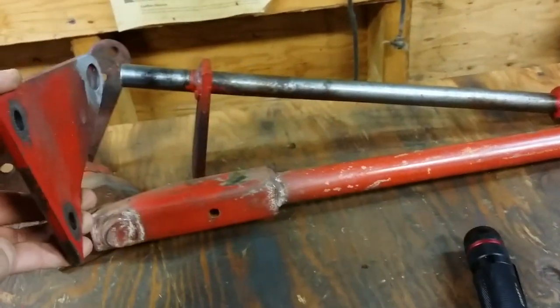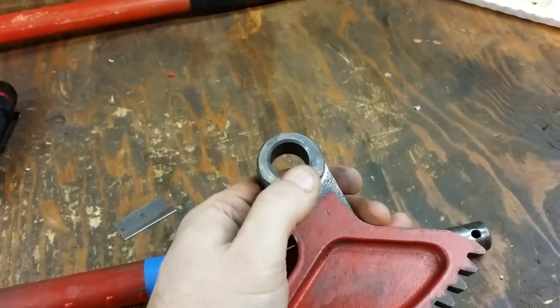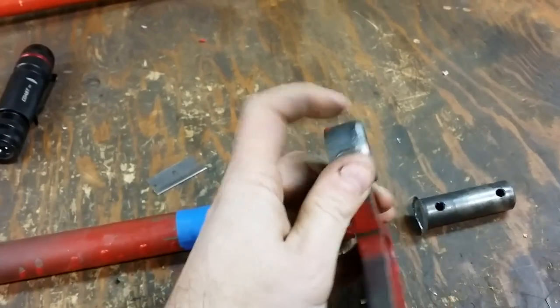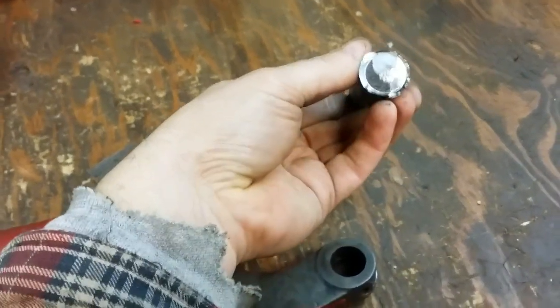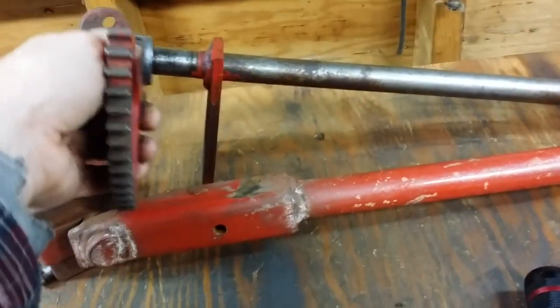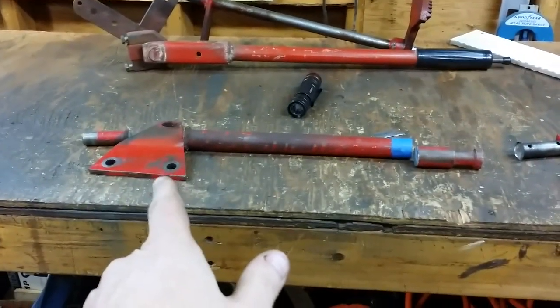I'm not using the original bar — it's just a piece of three-quarter inch bar. The tie rod mount slides right on with no issue and I can make my adjustments where I want it to be. The gear was interesting because the weld holding it on was extremely hard — my hacksaw wouldn't even cut into it. So I cut just outside the weld, took it to my bench grinder, ground the weld down until I could see the three-quarter inch end of the bar, then whacked it with a ball peen hammer to knock it out. The gear fits super nice onto a piece of three-quarter inch bar stock. I already bought a new piece from Tractor Supply, I'll cut it to rough length, fit it in the tractor, and start planning out where the gear and tie rod ends are going to go.